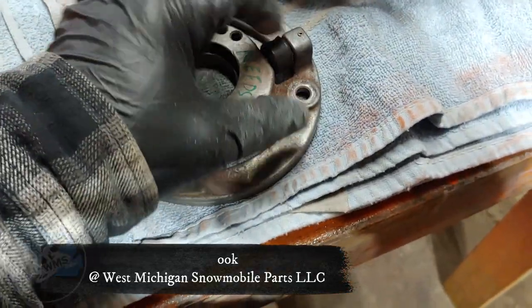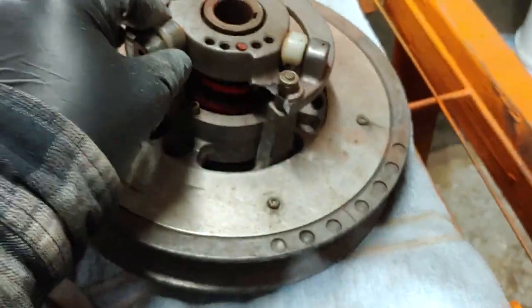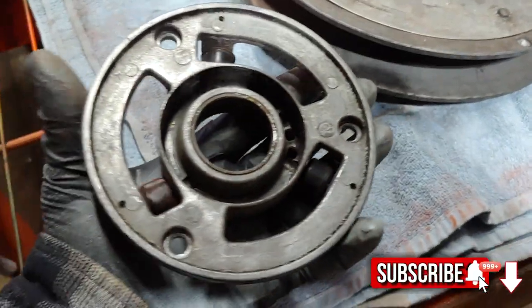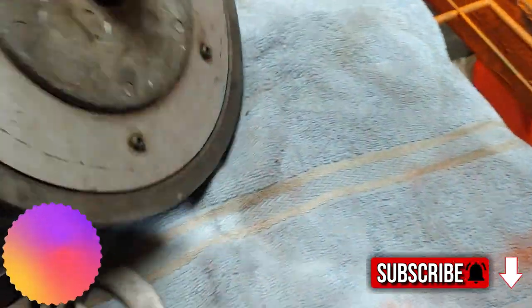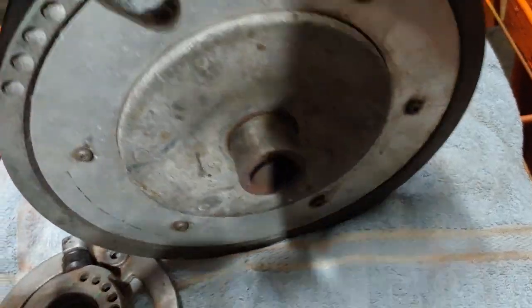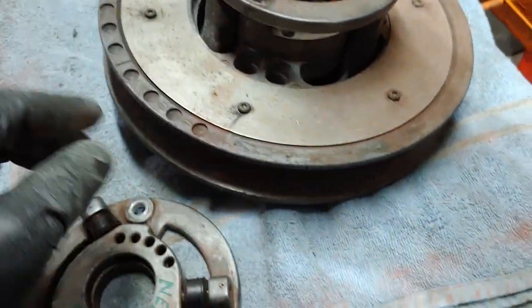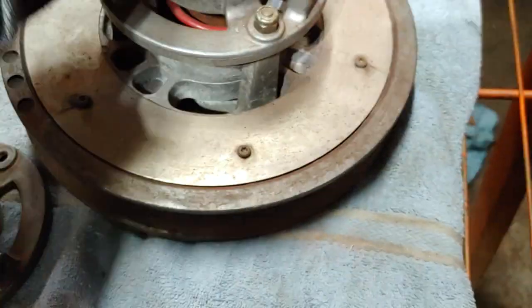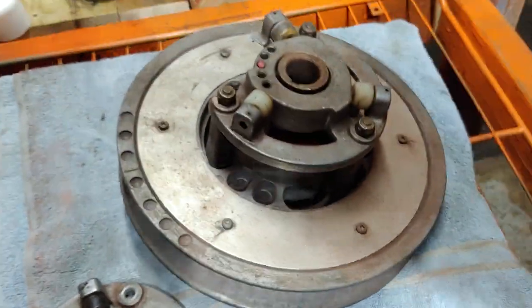Same thing, just needs to have the rollers replaced, and luckily the rollers on here are in pretty good condition, so I'm gonna go ahead and use those. But yeah, this thing's pretty dirty - it's been sitting in my garage. They're both kind of dirty and grimy, but either way I'm gonna tear it down, separate the sheaves, take the spring out, take the rollers, swap them out, probably put new bolts in, clean everything up, and then reassemble it and show you guys the outcome.